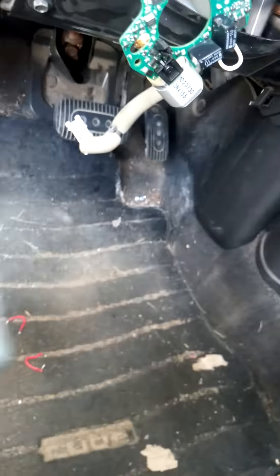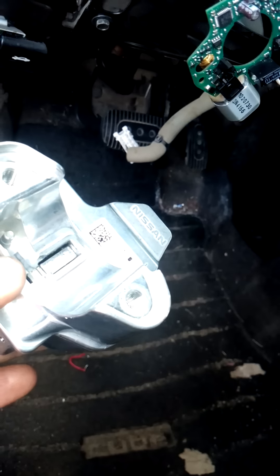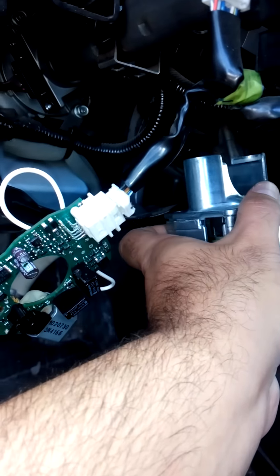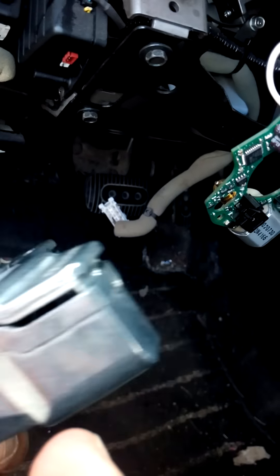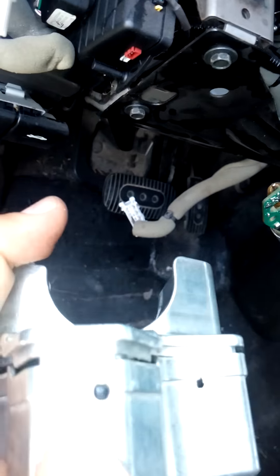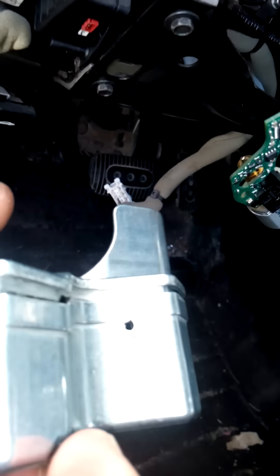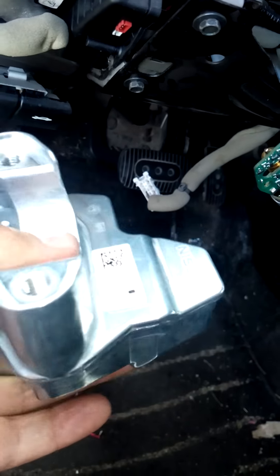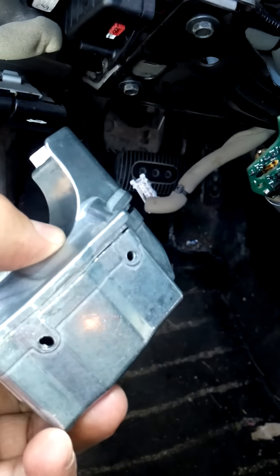I've figured out the workaround. The steering lock is mounted underneath the column. There are four rivet locations on each side. What I've done is drilled out the rivets. When you're drilling out the rivets, make really sure not to go too deep, because if you go too deep and puncture through, you're going to damage the circuit board inside.